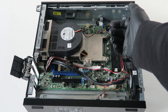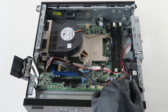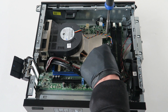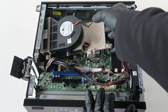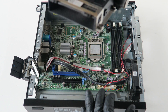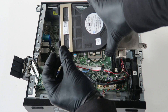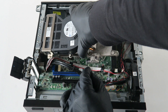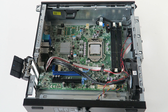Take your finger, lift it up, and the heatsink should come right out. Make sure all screws are fully removed — if it's still locked, unscrew the remaining screws on top. Lift it up and the processor cooler heatsink fan comes right out. When putting it back in, you'll see two mounting holes — you can't miss them — and it goes back in really easy.